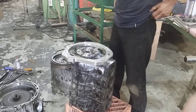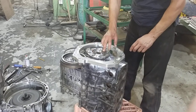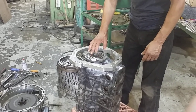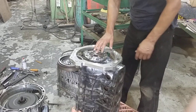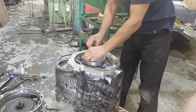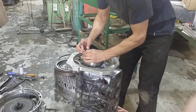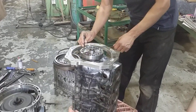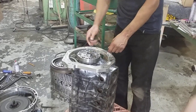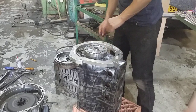Then we've got a two-piece crank adapter. The first piece drops onto the crank — you use your OEM bolts there, or ARPs, whatever it is you want to use — torque that to the same specs as factory. Once that's bolted down, we've got the second part of the adapter which then sits on top there, and then these 10x1.25 bolts you can torque to about 65 Nm. And that's your crank adapter done.